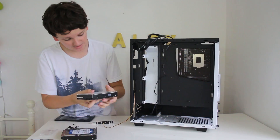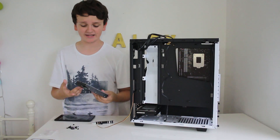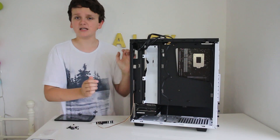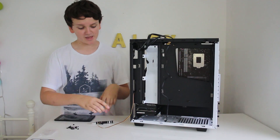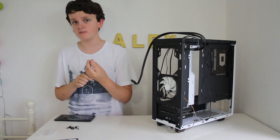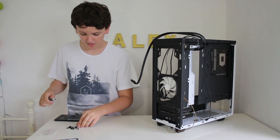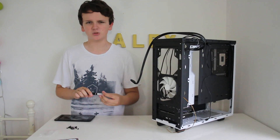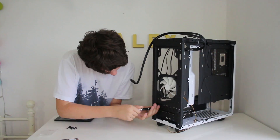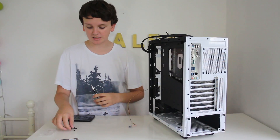To install one of these 3.5-inch drives, simply slot it into its bay. The drive bays have space for two 3.5-inch drives, and below the bay you can have one 3.5-inch or one 2.5-inch drive. To bolt in the hard drives, use the same screws we used for the motherboard and screw them into place using the pre-aligned mounting holes — just make sure the drive is aligned before you screw so you're not drilling into it. Once the front screws are in, move to the other side of the drive bays to add two more mounting holes for security. I'd also note: never put the power supply in first, as it'll make it impossible to reach these screw holes.